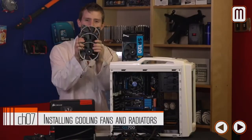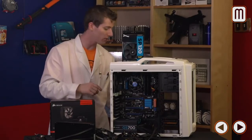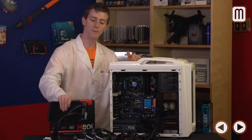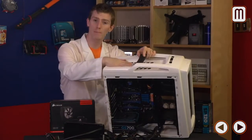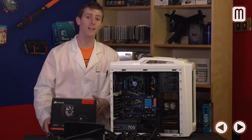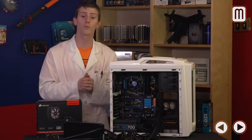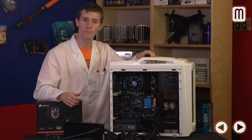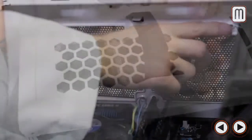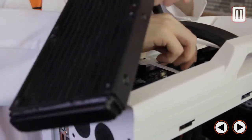We could have used the fans included with the H100i, but we're using the SP120s with the little white mod rings on them. Corsair includes white, blue, and red rings in the box so you can pick your color scheme — we went with white to match our white case. Not everyone would want to use an H100i in this case because of the slightly unusual mounting situation where you remove the top plastic plate and mount the radiator partially externally. If you're not into that look, go with an H80i instead — it's a single 120mm radiator, doesn't perform quite as well, but keeps all components inside. We'll start by removing the stock Intel cooler.